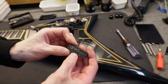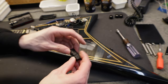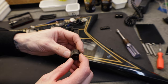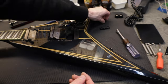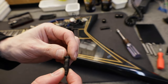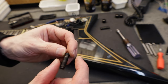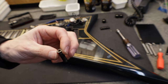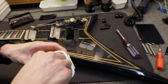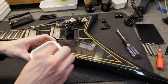Here is the nut that I pulled out — it says made in Germany on the bottom, R3. I'm going to lightly round that spot over with a file and clean it up with some naphtha. The screws that go inside the knobs were really nasty — lots of dead skin and general finger grime — going to clean those up. These tuner buttons have a little bit of paint missing but overall they're in really good shape. I'm going to leave them in naphtha overnight with some 3-in-1 oil mixed in, then stick them inside a drill and clean out the holes with some sandpaper — these will be good to go. Some of the other parts I pulled out have rust on the screw heads, but that's another thing I can clean up with naphtha and 3-in-1 oil and an old toothbrush.